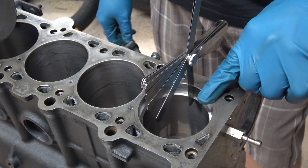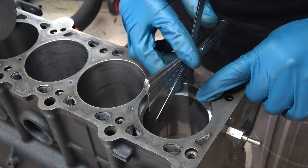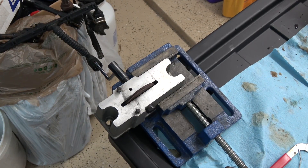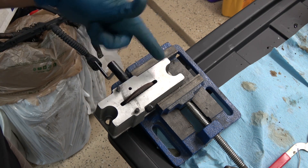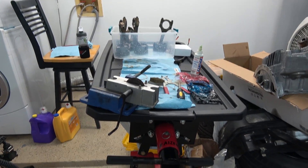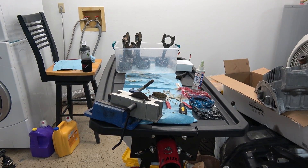If I were using a factory gap I wouldn't have to grind them, but I will be grinding this ring to file it to the right size. I'll now use my piston ring grinder, which I set up backwards — I'm going to have to put it the other way. It's very difficult trying to be resourceful working in the house. I don't have all the equipment from the shop, so I'm managing with what I have in the garage. I don't have a table, so I'm actually using my old engine as a table, with a container lid and some shop towels, and I'm using the piston ring grinder on top of that.